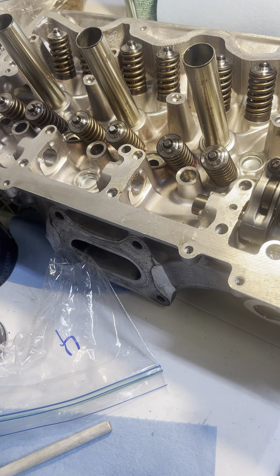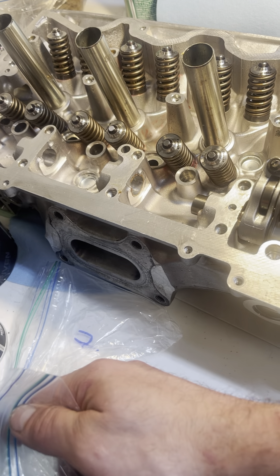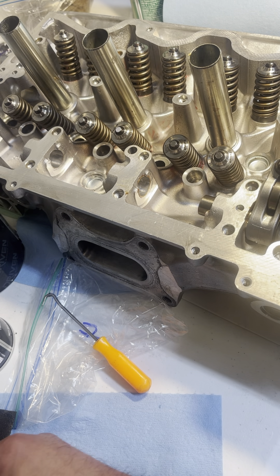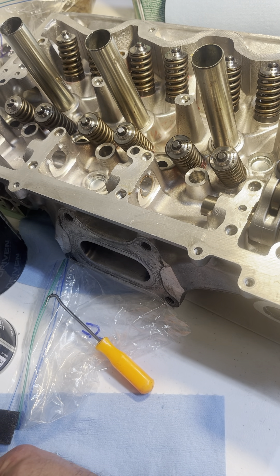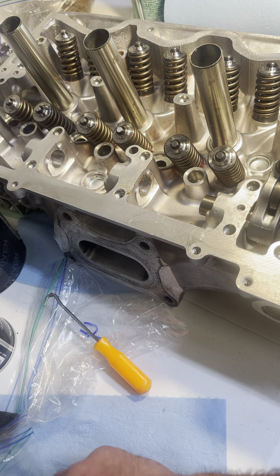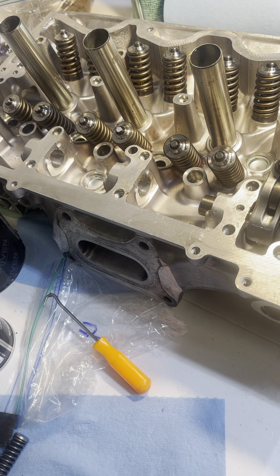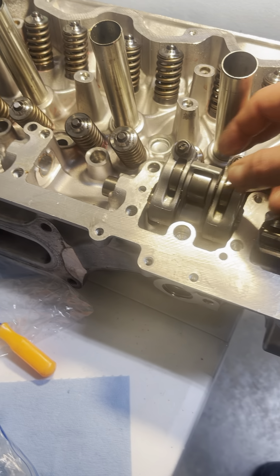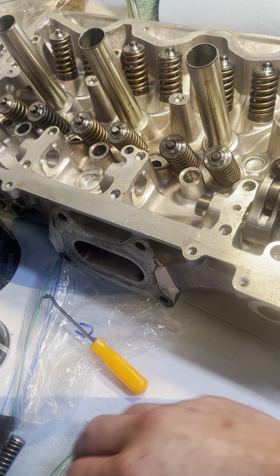When it comes to the basics of parts, I always label my bags when I take things apart — labeled 1, 2, 3, and 4 — although that's really not needed in this scenario. Honestly, when it comes to the rockers, if you've got enough wear where you have to label them cylinder to cylinder, I think it's about time for new rocker shafts and rockers. We used to use something like an LMA to stabilize the center. That center basically free floats until VTEC kicks in.